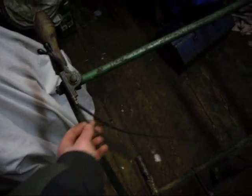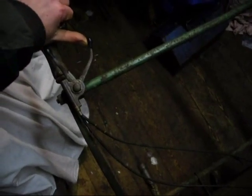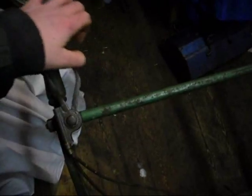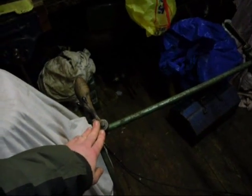The other job I can't do tonight — I need a new throttle cable because it was busted. When I went to start the thing yesterday and put the throttle on, it snapped — the little thing on the end came off. I've crimped a bit of pipe on the end, which is just enough to hold it for a test run so I can get the throttle open, but it won't close down fully. So I really need a new set of cables, which means having to get a new one of those because you can't take it apart. You need that, and then you can hook them on.